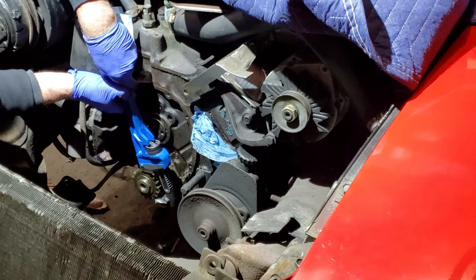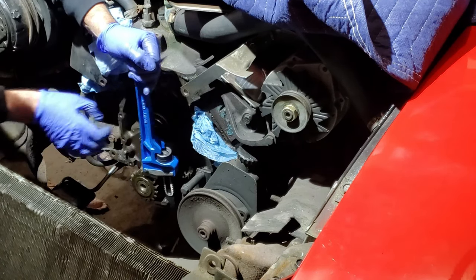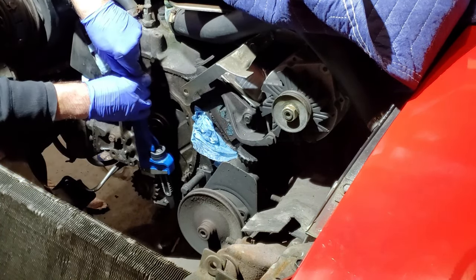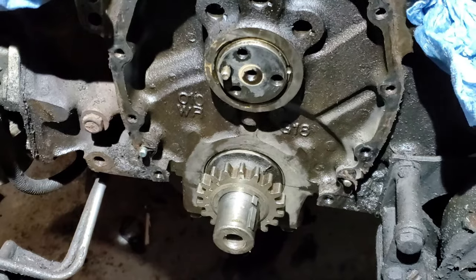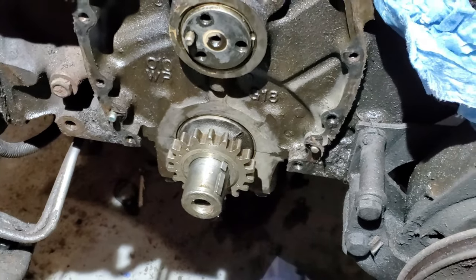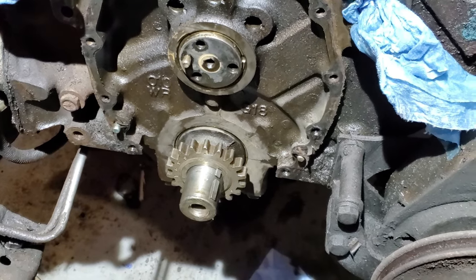So I'm looking at just rotating it a little to the left to get it lined up properly. You just want to make tiny small increments in your movement and just nudge it back into center. So you're better off to do tiny movements as opposed to one large movement to get it back in position. So there we have it so far. You can see that I've been able to back off the crankshaft, so I've got that indicator straight up now. So we'll be good to put on the camshaft gear in a moment. So that one's all set up and we're good to go. So let's get the other one going and try that out.